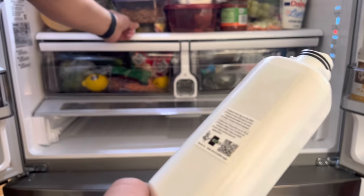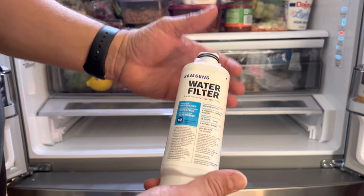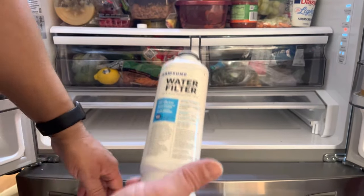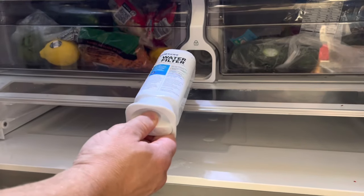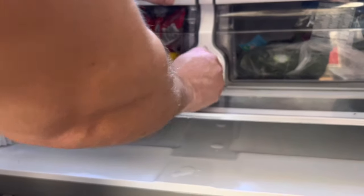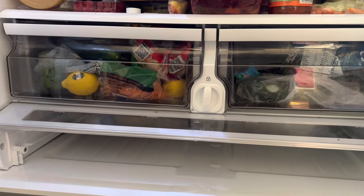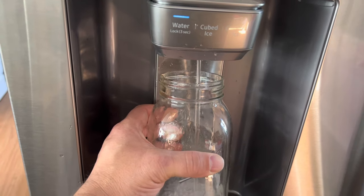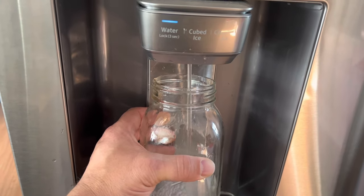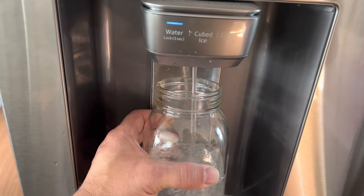The water's off and I wiped up some of the water. This Samsung original filter has to have something in it to communicate with the refrigerator, so you can't really use a generic one or the filter light will stay on. What you want to do is push the filter in place and turn it clockwise and it'll lock in. Now we can turn the water back on at the back of the refrigerator. Sometimes it takes a few cupfuls to get all the water to come out with no air in it — it'll bleed the air out of the system.